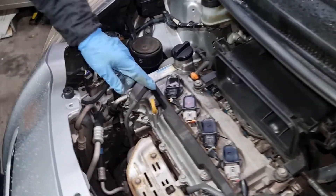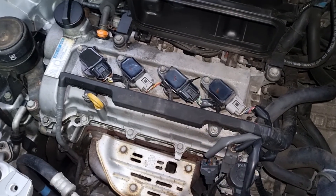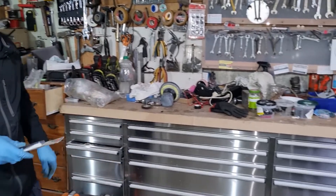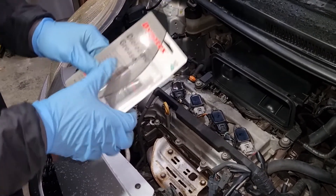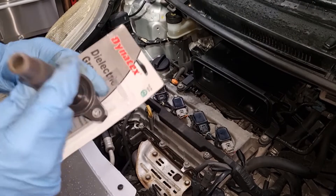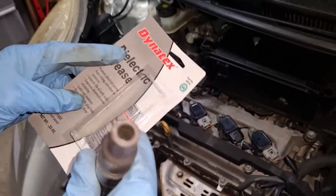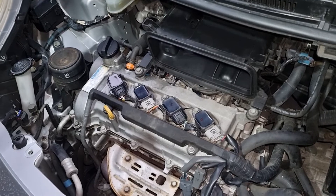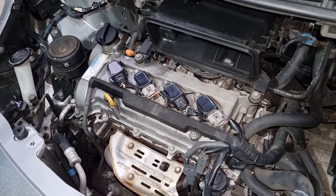If you're in a cold country or a country where it rains a lot, you can use a little bit of dielectric grease. Put the grease around here and you can put some over the spark plug tips — it's commonly done on jet skis and marine applications to prevent the plug getting seized. But because we're in New Zealand it's not really needed, and being easy to access these plugs it's not necessary. If you're working on a hard-to-reach V6 or a transversal engine then it is beneficial.